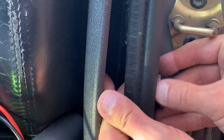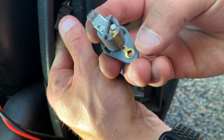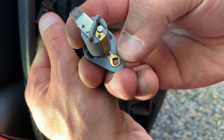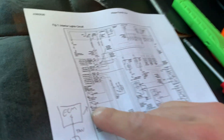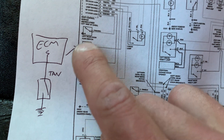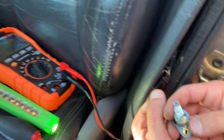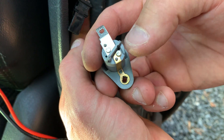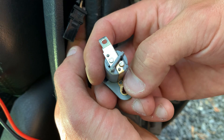I'm going to remove the switch just to show you what it looks like. It's a plunger type switch — a simple open and close switch. The back of the switch, when I screw it down to the chassis, that metal strapping is the ground. So as you look on this schematic, notice the ground symbol is right on the component versus a wire. This tells me the component itself is the ground. You can see the two contacts of the switch: the wire coming in from the computer, and this part going down to the screw that grounds it.